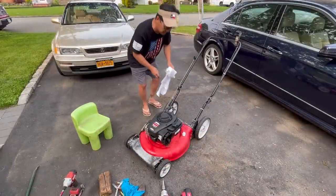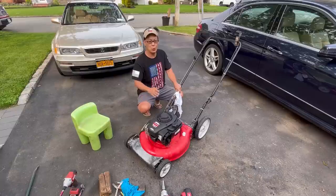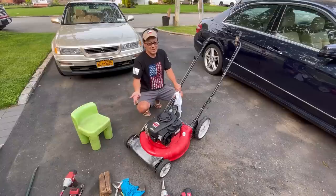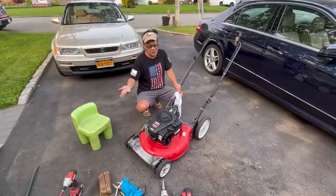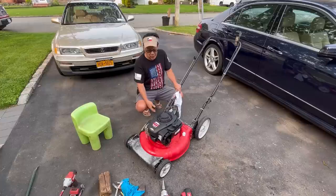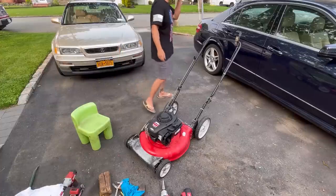Strange. Took the spark plug out, stuck the screwdriver in there. It's the only way I know how to do top dead center to check the valves, and it was way off. But it wouldn't even tighten very much. You know, I didn't want to break the bolt, and it just seemed like it wouldn't tighten anymore. Tried and tried without breaking the bolt, tightened it as best I could. It's still off. It's like 8 thousandths. Supposed to be like 4 to 6, you know what I mean? But it's like 8 or 10. But it's tighter, and at least the rocker arms are on it.